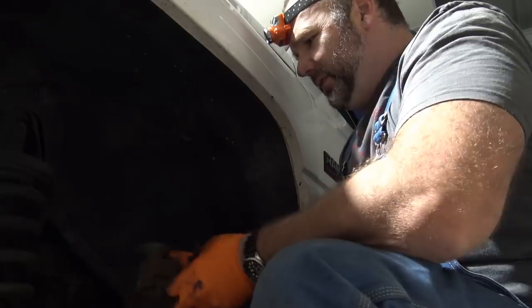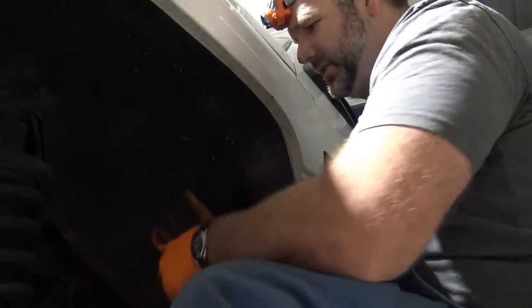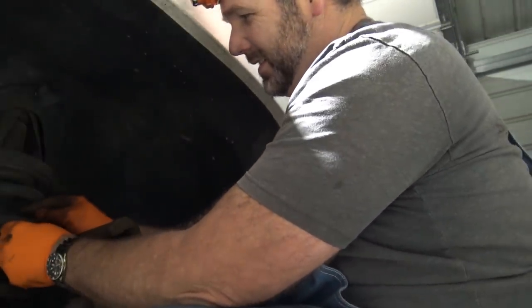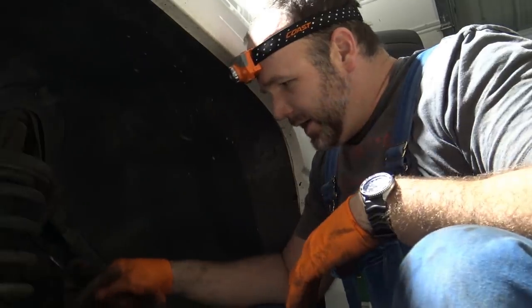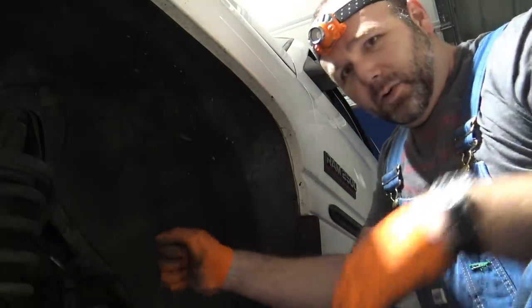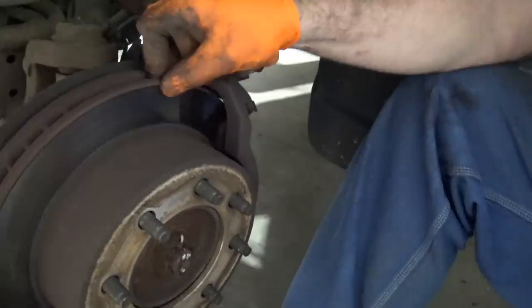In case you've never done a brake job on your own vehicle — it's not that complicated, and it's not that expensive to have somebody else do it either. I like to know everything about a project when I finish it, and YouTube also gives me a nice record of when I did what. The caliper has one brake line going to it with brake fluid — you don't want to open that line and introduce air into the braking system. There's also a wheel speed sensor right beside it. We're going to pull this piece off and replace the rotor here too. This rotor is loose; it's not in terrible shape, but since we were already doing one, we might as well do the other.